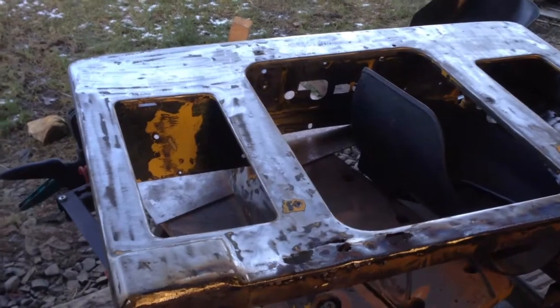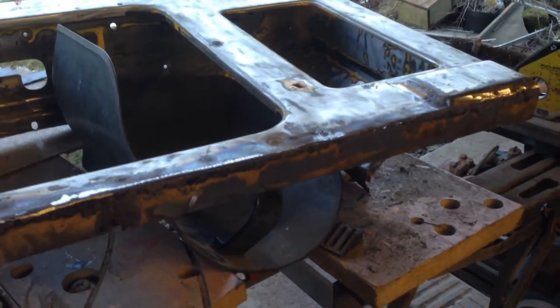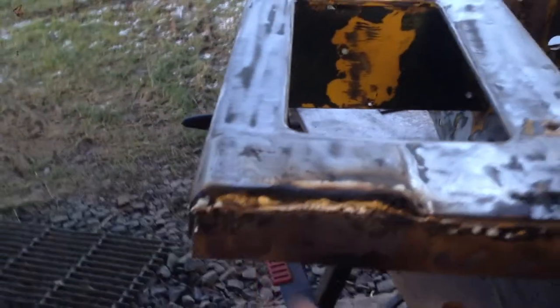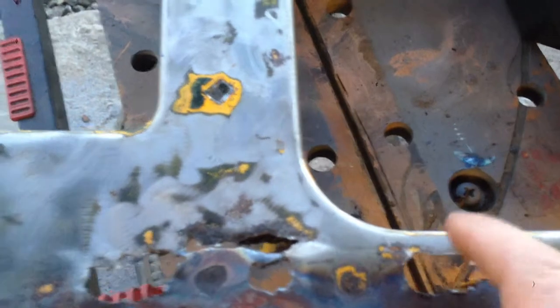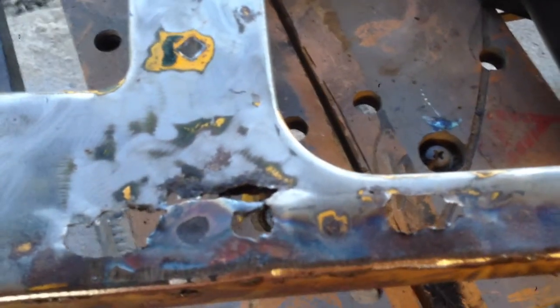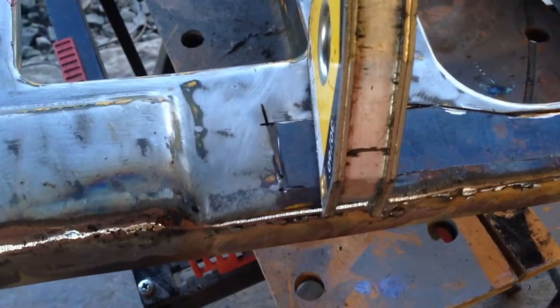This is the Land Rover grille and underneath it you can see that's all new. There's basically this new piece of steel that's going to need to be drilled, but I've replaced that whole section underneath it. I've got a couple of holes here you can see quite clearly. I'm going to cut that out and use some scrap metal — I've got two mil scrap metal here — and just make another piece. You can see where that's been cut and the new bit is actually held in place by that magnet. It's not a perfect match but I'll be able to fill that with some welding.